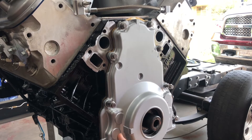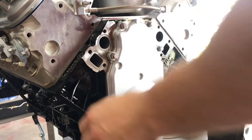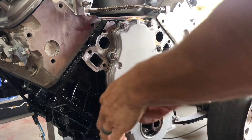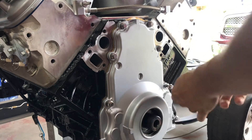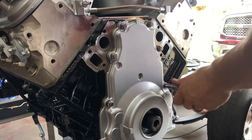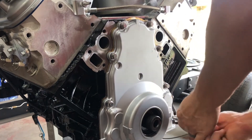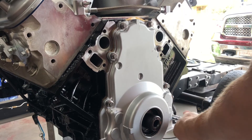They're reusable — they're not a one and done. ARP head bolts are reusable on LS's, unlike the torque-to-yield GM bolts, though people do reuse those. Like I said, I Loctited all of my ARP hardware, and we will torque it down once we get the alignment correct.